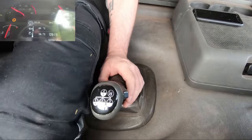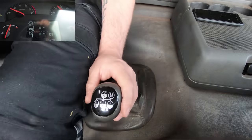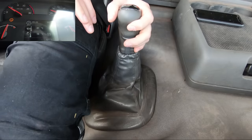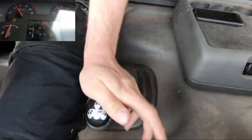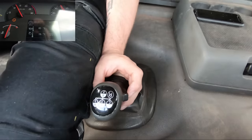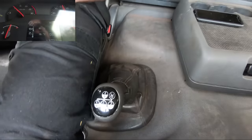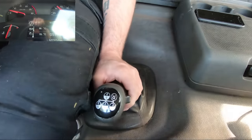We're going to put it in top and just cruise. At the roundabout we'll go low and into fifth at about 20 miles an hour. Ignoring the splitter this time, straight into sixth at around 1500 revs — that drops us down to roughly a thousand revs. Then at 1300 revs we split that, and it took us down to just over a thousand.